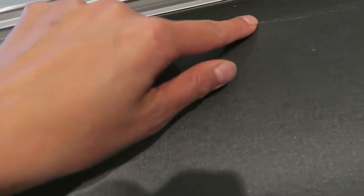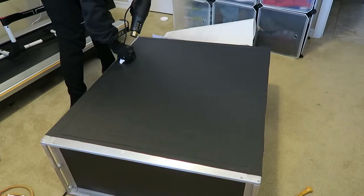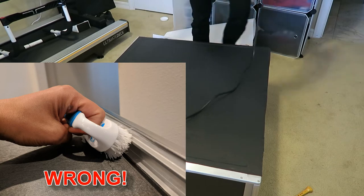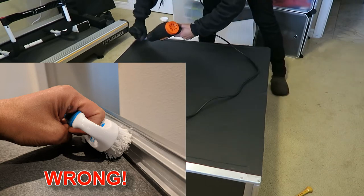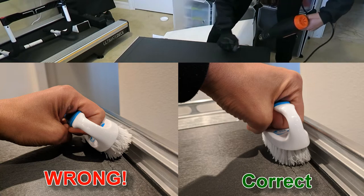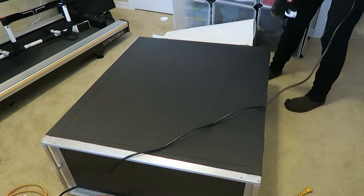For my first mistake, I had no idea why this large scratch appeared. But while I did one of my panels I figured out how I was scratching it - I was leaning my nylon brush too far to the side causing the plastic part to rub against the vinyl wrap. So keep your brush straight up and down and not to the side.